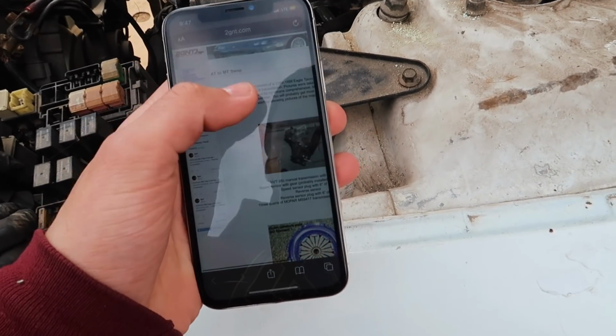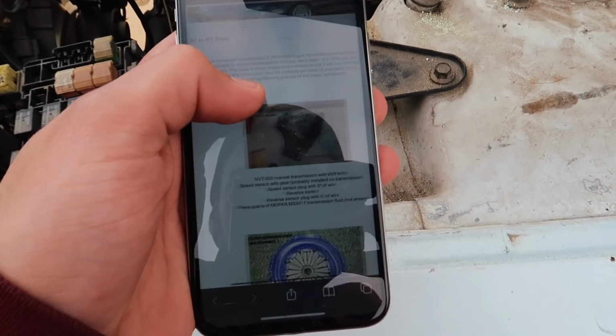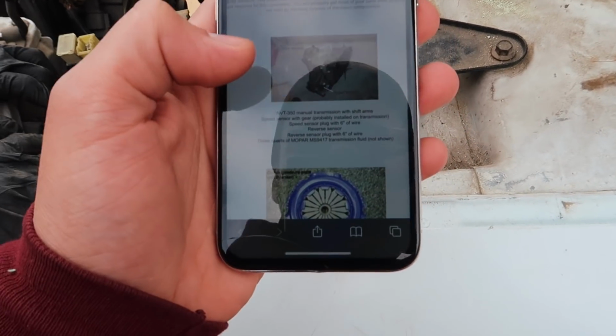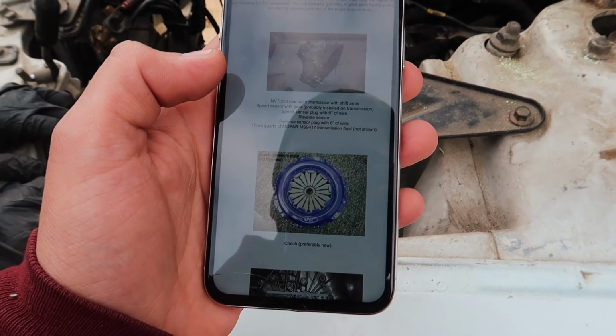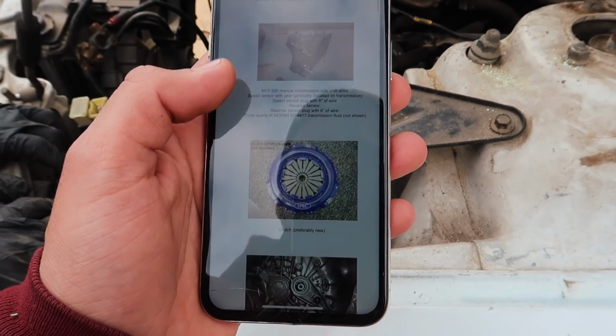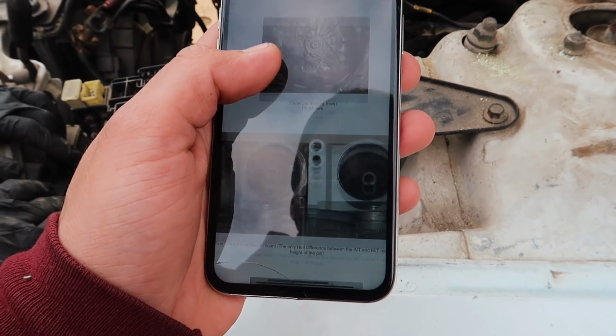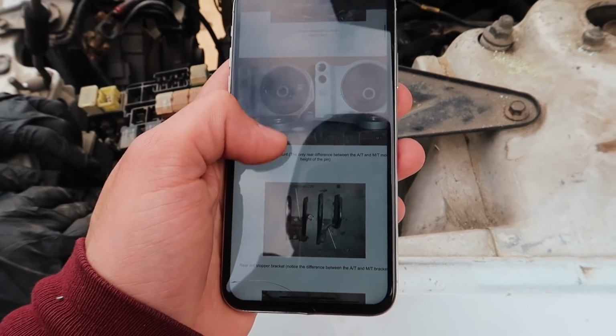Alright, so we pulled up the full build thread on 2GNT.com. If you guys are looking to do this, I'll put the link in the description for you guys to see. It's basically saying we're going to need the transmission with shift arm, speed sensor with gear, speed sensor plug with 6-inch of wire, reverse sensor with 6-inch of wire. Of course, your clutch, your throw bearing, we'll get that new. You do need the transmission mount. There's a difference between the manual and automatic.